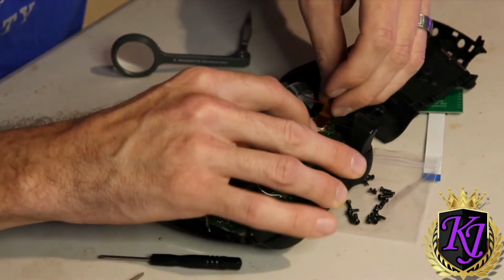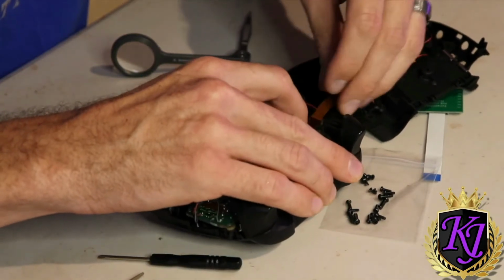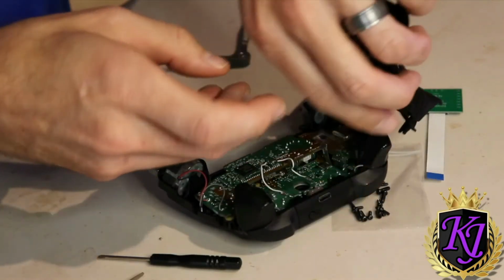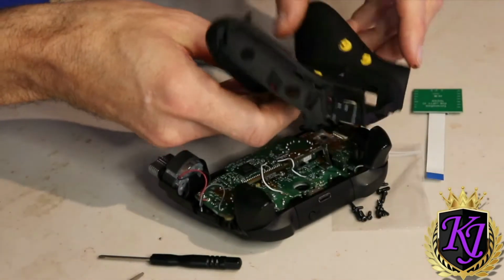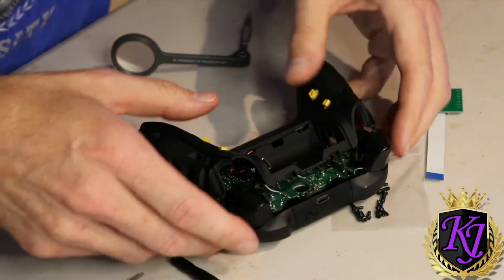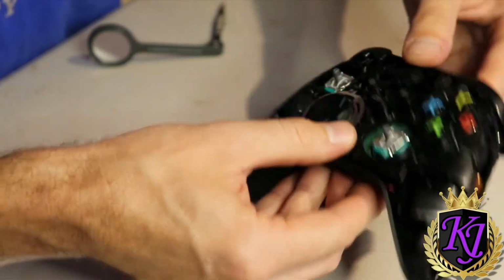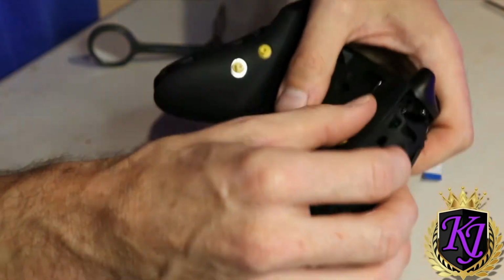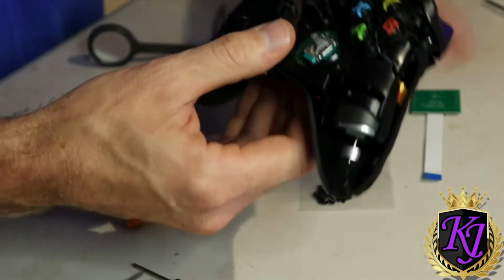And finally, you're going to take the clamshell, it's got the buttons in it. You're going to attach the ribbon cable to the ribbon connector where the test light was popped in. And you're going to put the clamshell back on the bottom of the controller and snap it together. So everything's back together for the most part. The back plate is on and it's plugged in and the buttons are connected. So that's basically it for that piece.